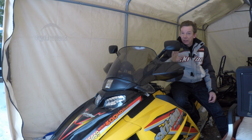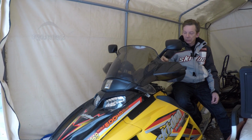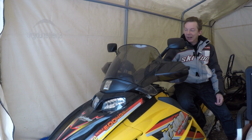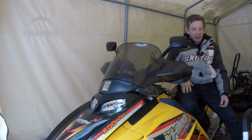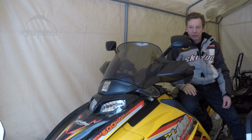All right, our season's got off to a lousy start. I've said that before, and I'm 99% sure that the reason that these plugs are fouled is because, like a typical kid with a new toy, I've been sitting out here, starting it, running it for a few minutes, shutting it down. I did that a few times, and I'm pretty confident that's why these plugs are fouled. And don't mock me, guys, because I know you've done it too.